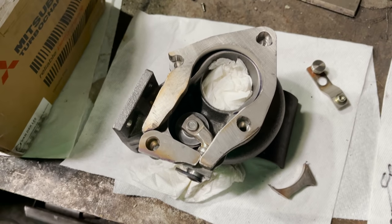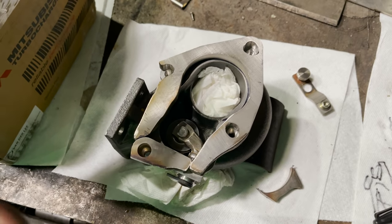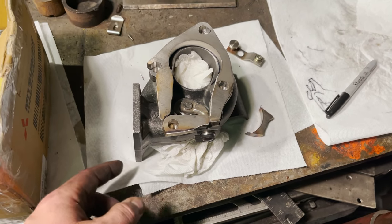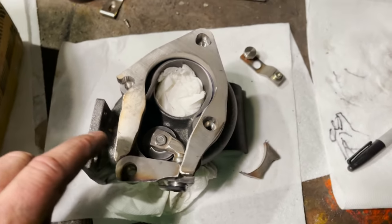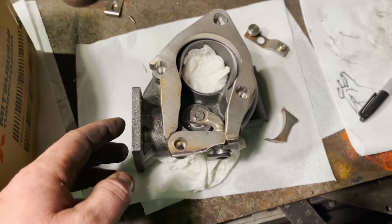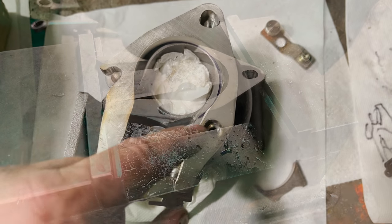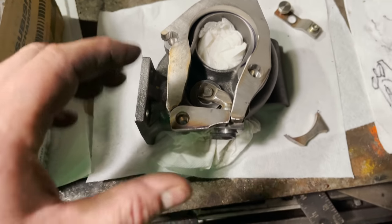Alright, this one was tough. Unfortunately the flange I bought didn't fit — it was for a DSM and didn't realize it, because it's the same bolt pattern but larger than what I had. What I have is like the same thing but shrunk down about 10%, so nothing lines up. After research, what I have is a Kubota bolt pattern and there is no flange available because the only thing they have is that cast iron elbow that goes to a muffler and weighs 30 pounds. So I decided I'll make this flange work.